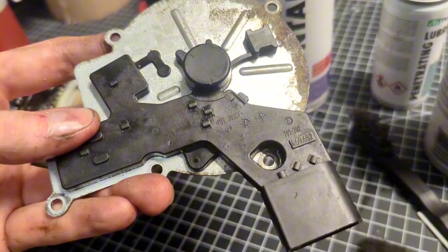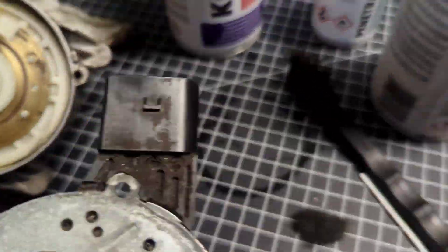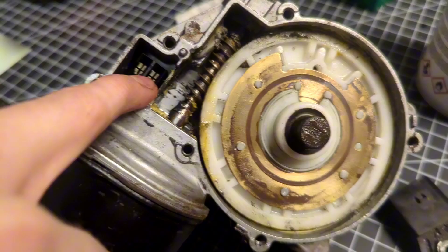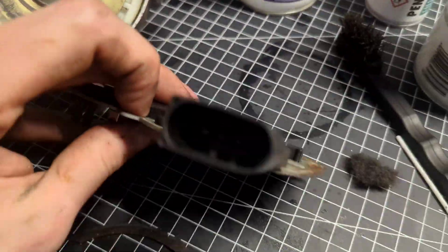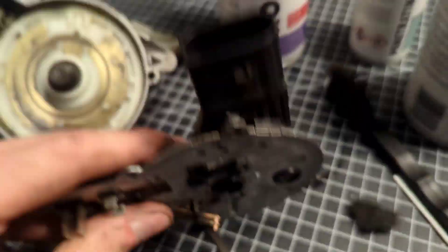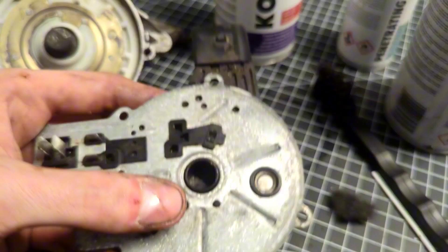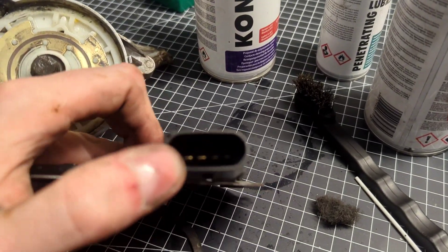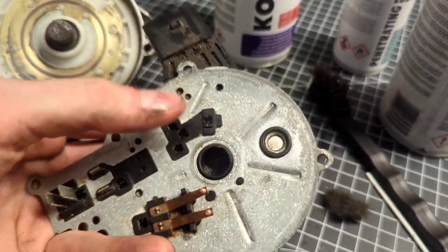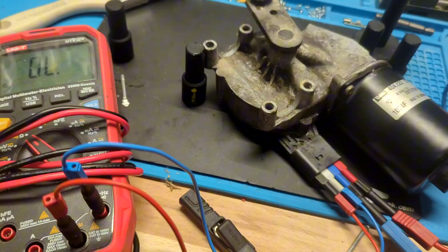All of the wiring seems to be integrated in this part already. There are four pins: two go through the plastic and slot into the motor, and the other two connect directly — those are what give you the pulses. So the wiring is really simple. You could probably troubleshoot this by putting 12 volts on two of the motor pins to make it spin, then probe the other two pins to see if you're getting pulses.